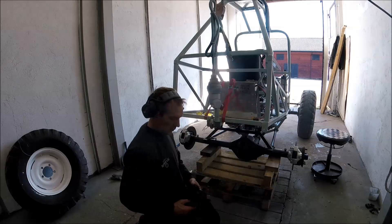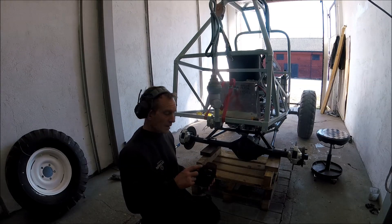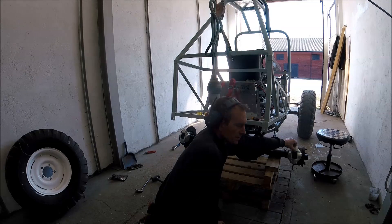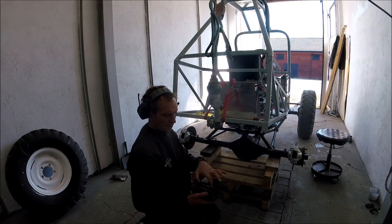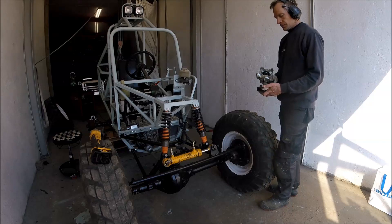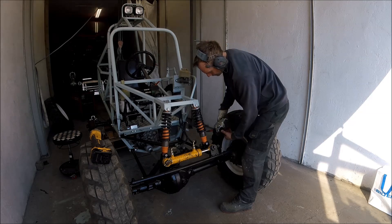I'm working with the brakes — these calipers were broken and I had no idea what they were, so I bought some from a Volvo 700 series. But I have to make new fixing points because the center of the mounting holes was not in the same position. On the front I'll use the old part from the brake caliper to get the correct fixing points to the axle, so I'm going to cut here and make a plate to get this in the correct position.